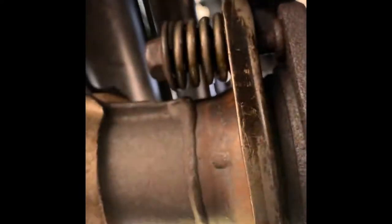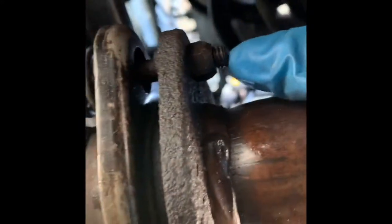Okay, so there's two size 14. And this is under pressure with the spring. And a bolt nut, too. So I just have to remove those two, and then I can pull the exhaust manifold so I could drop the old pan.